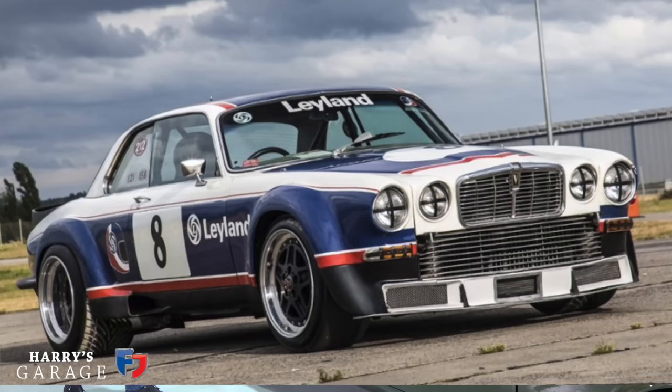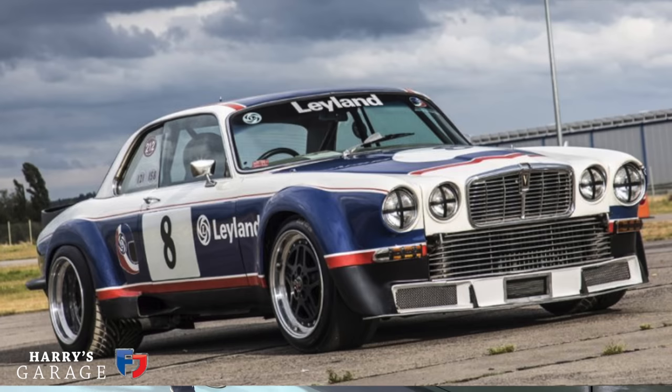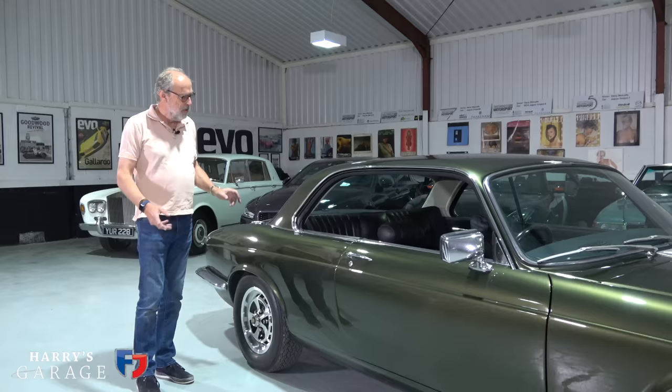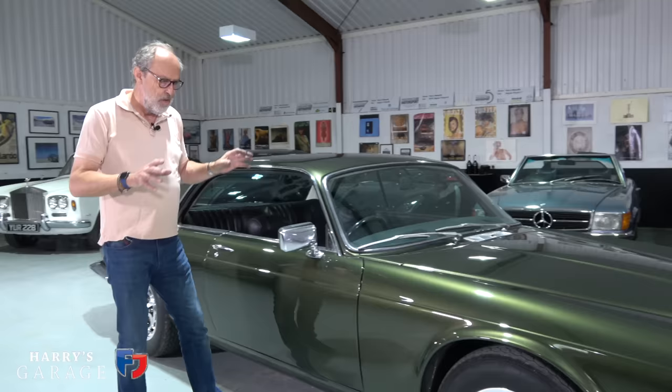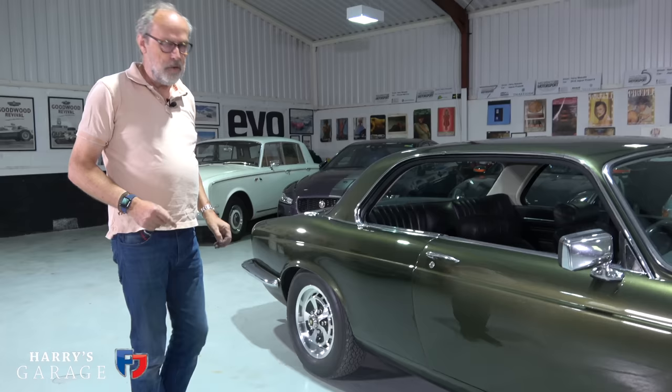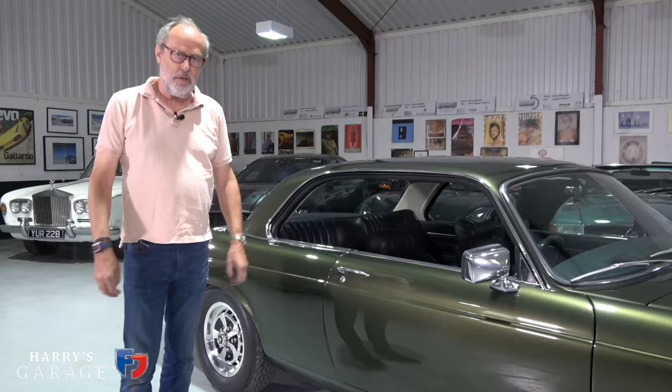It was a problem they had with the Broadspeed racers. They had a dramatic reinforcement to try and hold the rear together, and if you over-tire it, you get cracking here because the A-pillar is so slim and the torsional rigidity is not great. So I do not want to overload the chassis, so I want to put period rubber on it and keep it narrow, which is also the reason I didn't do a Steed conversion.